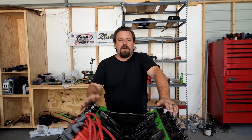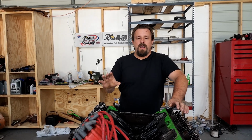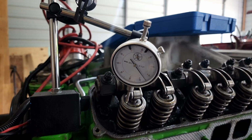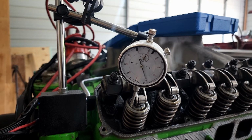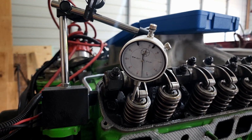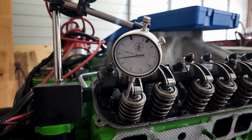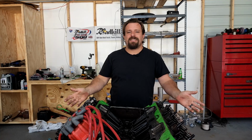I made a couple of phone calls and I can't get a straight answer as to whether or not the valve springs will collapse or are supposed to collapse a hydraulic lifter. The general consensus is no, they're not. And they're definitely not supposed to be loose when they come back up. And so we have a problem. I gotta fix, it's gonna cost next to nothing.